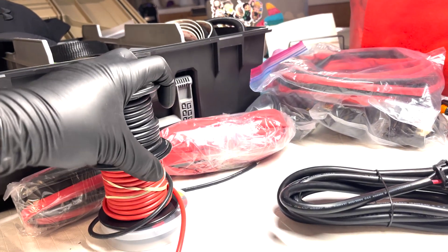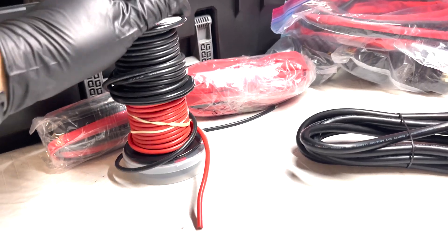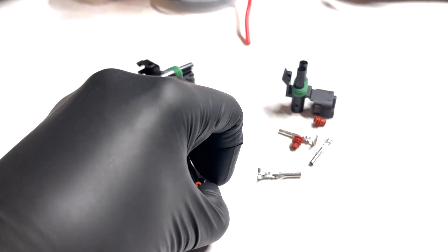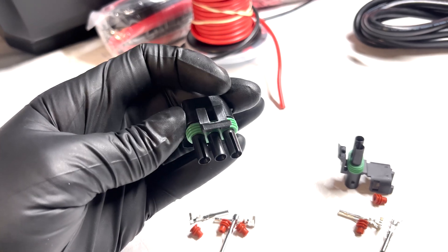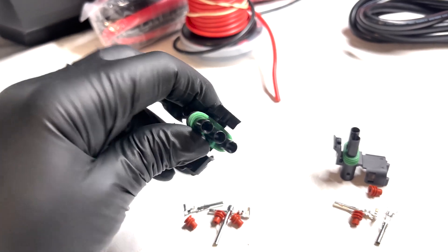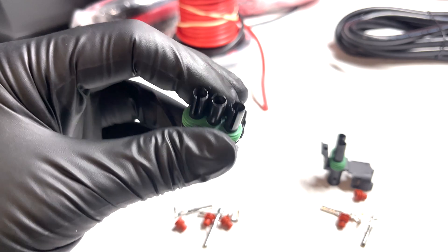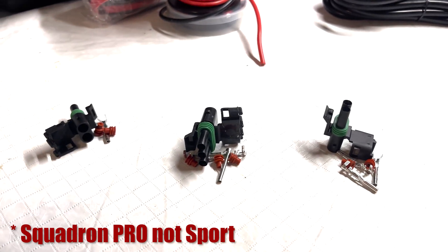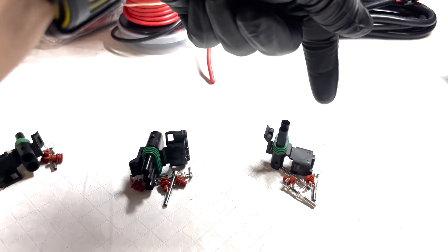I'm going to be building a wiring harness about 42 inches long with three junctions. The squadron pros require a two-prong connector on the passenger side. This is the S8 30-inch light bar — it has a three-prong for auxiliary lights. Since this application doesn't have a DPDT switch, I'm just going to stick with the two ports so only those will be active. Then there's the driver side squadron sport, making up all three.